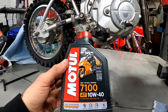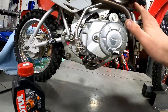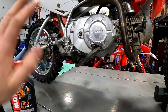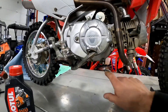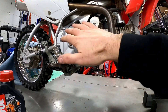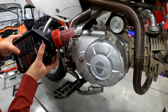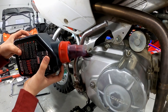The last step is to refill your engine oil. We like to run Motul oil here at our dealership. After everything's been reinstalled, this is our last step, and then we'll check it on the dipstick. The manual calls for one whole liter — check your model year — so we're going to put this whole thing right in there. This drain bolt is already torqued earlier in the video, so make sure you torque that. Go ahead Braxton, fill it up. The Motul oil is nice because it has the filler spout built right into the bottle, so refilling is easy.